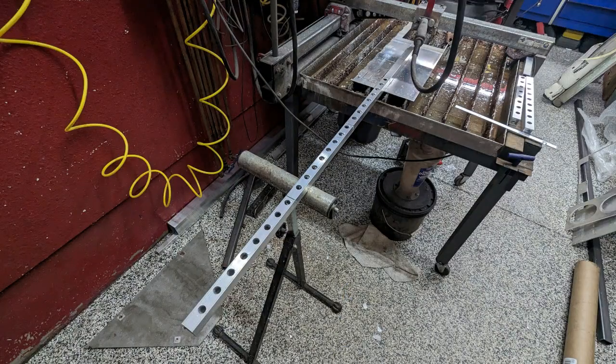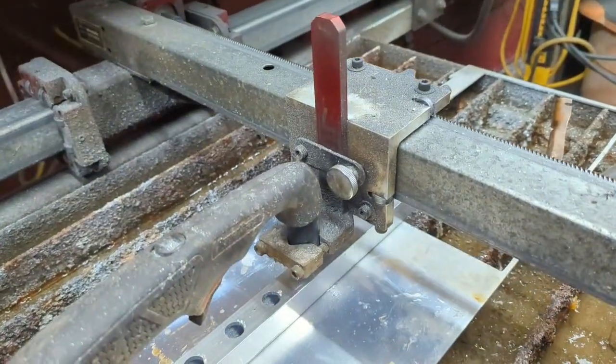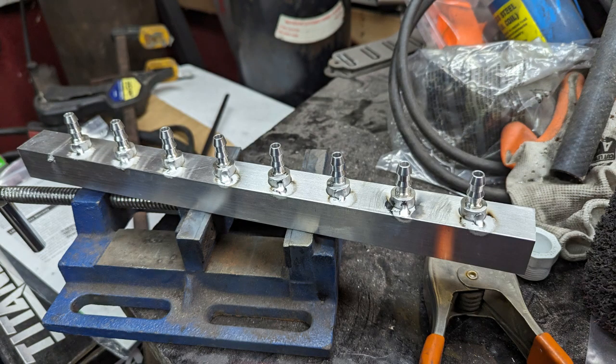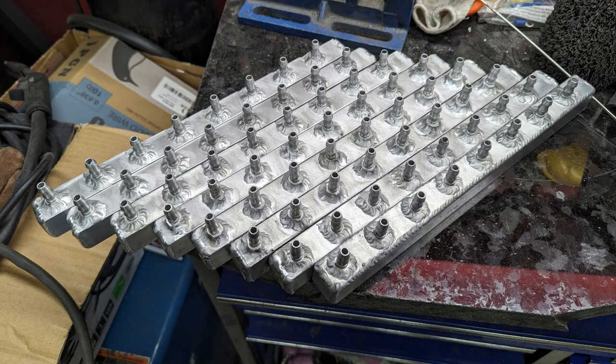In order to maintain temperature in the battery pack, each box needs coolant manifolds to evenly distribute coolant to all 32 cooling loops in the battery pack. I used eighth-inch wall one-by-one aluminum tubing and jigged them up into the CNC plasma table so it could evenly cut all of the holes, as well as cutting the manifolds to length. Then I cleaned them up and they were ready to weld the aluminum fittings. I jigged the fittings from the bottom and top with a spacer at the desired height, then capped them with a top jig to get them all square. I tacked them into place, then welded a few beads on each one at a time rotating through. Once fully welded, I capped them off to pressure test and check for any leaks. Now I've got all eight manifolds ready to go — 64 fittings total — and we just have to get them mounted in the battery boxes.